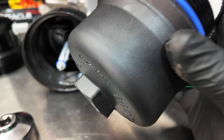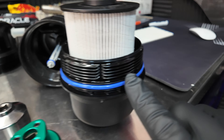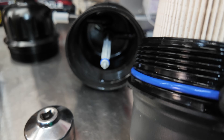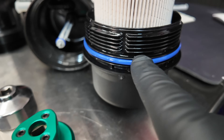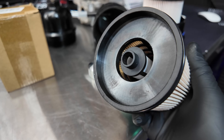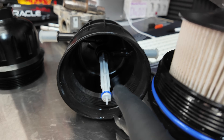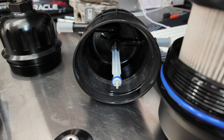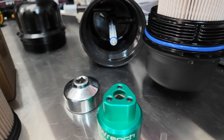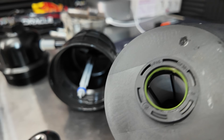While we're on the subject of fuel filters and doing everything properly: torque these down, guys — it's very critical. 18 foot-pounds is what these go to. Lubricate this O-ring — you can see how shiny this is, it's brand new out of the box. Before they assemble it in the box they're actually lubricating these. If you're replacing your fuel filter, replace this O-ring and lubricate it. It needs to seal right there — you don't want any water going through. You must lubricate this O-ring too, because if you don't, you run the risk of rolling that O-ring and then you have no seal, which means water can get through. I use diesel fuel to lubricate everything because it all lives in diesel fuel.